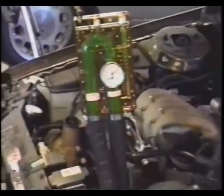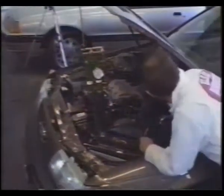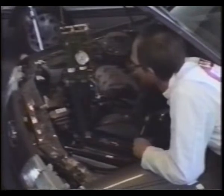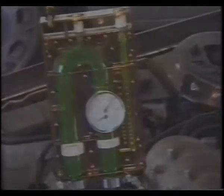D. Operating temperature. This test must be performed with no airflow obstruction in the front of the radiator. Therefore, it can best be performed at the end of all other testing. Remove radiator airflow obstruction and set the engine at fast idle. The temperature readings on the analyzer should drop gradually and hold steady at some lower reading. This will indicate the constant operating temperature of the thermostat.